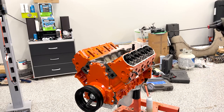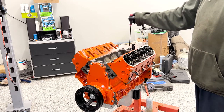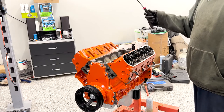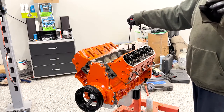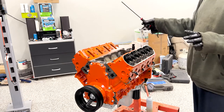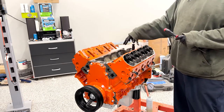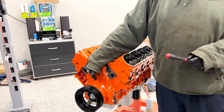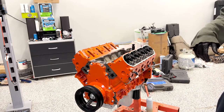So it's kind of like back in the day, you put a screwdriver in your drill to sort of turn the oil pump on like a small block Chevy. Of course, you never really drop the screwdriver in the crankcase and have to go fishing for it. That's why you use the correct tool. But if you didn't use the correct tool, you know, you fish for it. So you pump up the oil pressure just by hitting the oil pump. Well, on an LS, that's not possible because the oil pump's driven from the front of the crank. So you can't run the oil pump without also turning the crank.